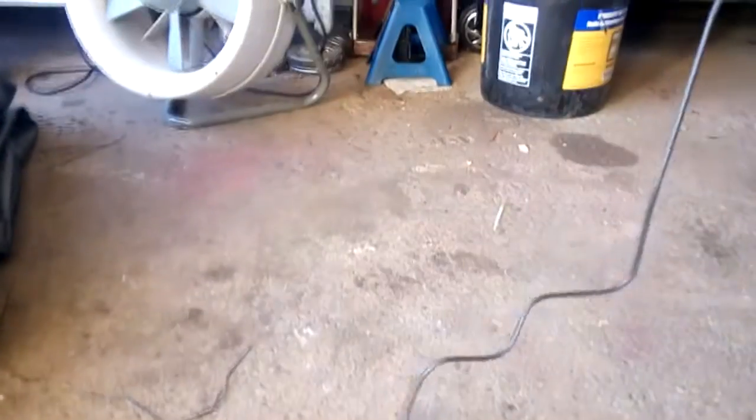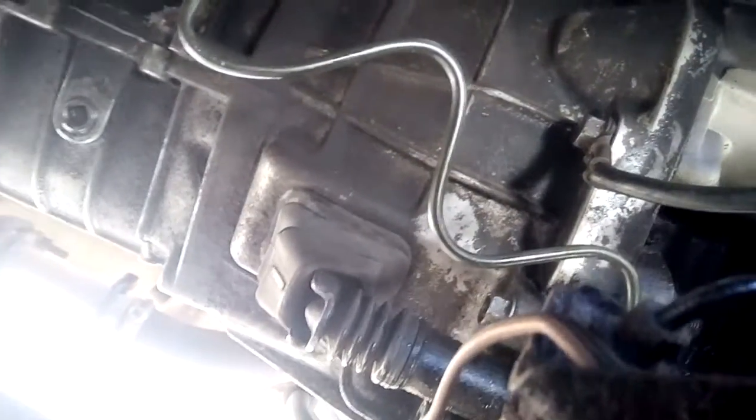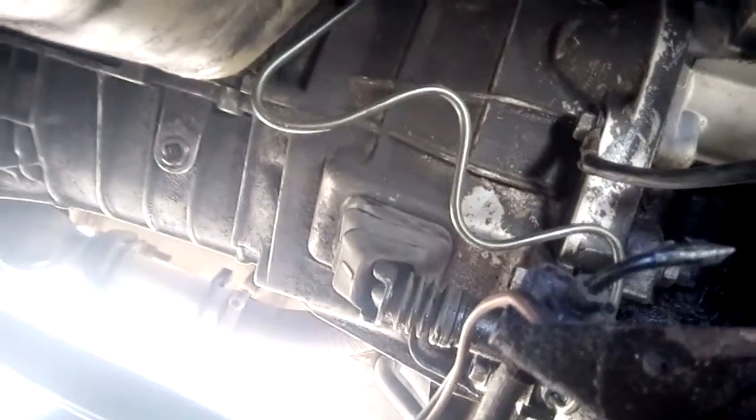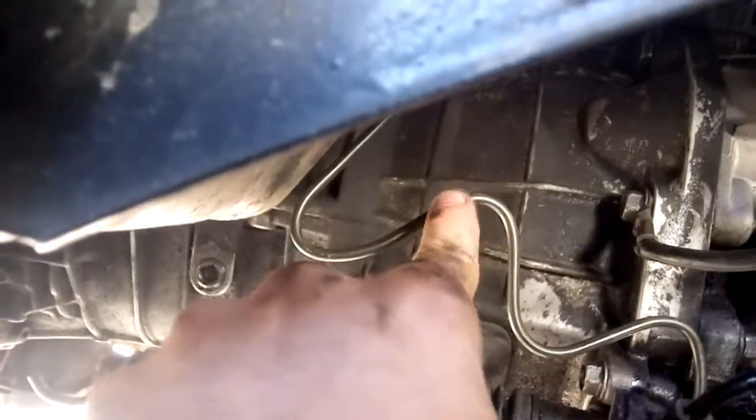Here's what I ended up doing. I ended up putting a little M in the end — I might accentuate those a little more so it brings it a little tighter in. I'm going to pull that out just a little bit more and make it straight. So I got that piece in there, I have the line run, clipped into there all the way down to the bottom. I put that zig-zag pattern in — it follows the body line down, comes back, and then zigs up and down and goes into the side. That's an easy way to shorten a tube that's too long rather than taking it back, because I don't know if they'll take it back if you've already bent it. But that's a neat little trick you can do. You can even still pull on this a little more, just be very careful because that's getting pretty much to the point where it's going to kink.